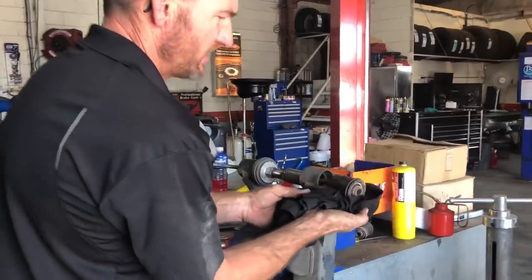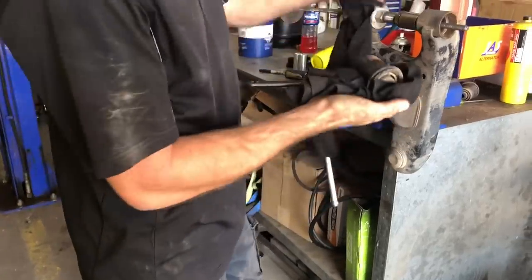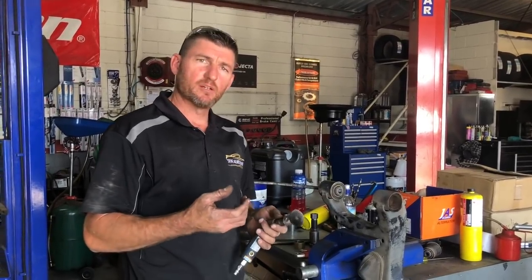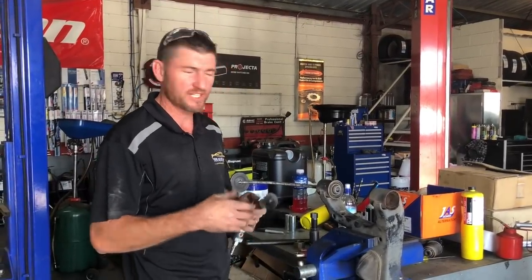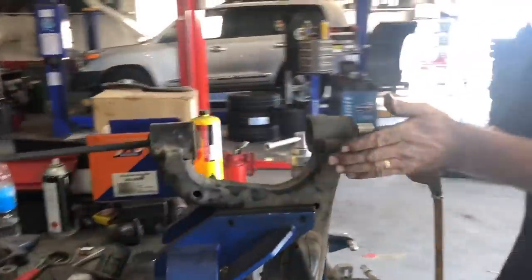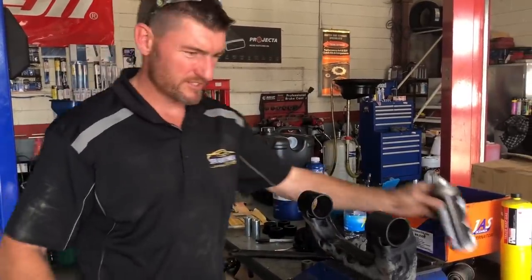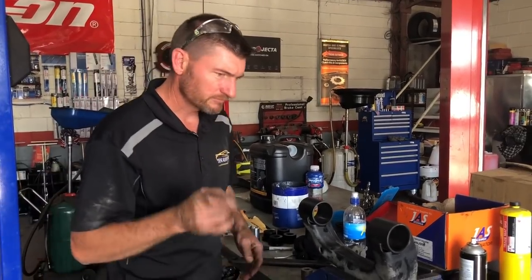You can see that sticky glue I'm talking about - it's sort of like a paste they put on there. A little bit of heat releases it and makes it come off a lot easier. I use a wire wheel just to clean up the inside - make sure it's nice and clean. If there are any thicker bits of metal, give it a sand. When you put the new bushes in, you don't want to damage them - it's the same process as any mechanical job, just make sure it's nice and smooth. I've pressed that one out too, cleaned it up, given it a bit of paint to stop it rusting. Now the critical part - the bushes.